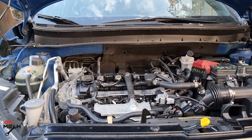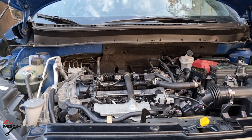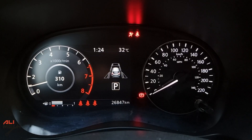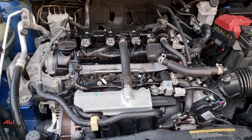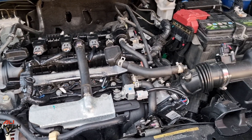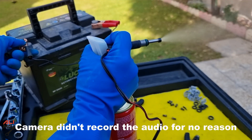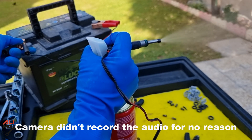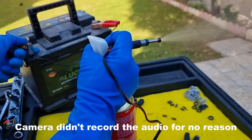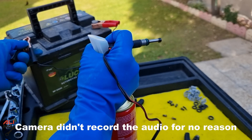All the wire harnesses and hoses are back on the engine. Now we're going to start the engine. It will start a bit late the first time — that's normal because the fuel injectors and fuel rail are empty and it takes time to refill them with fuel and push the air out. You should have a stable-running engine like this. If you experience a shaking engine after cleaning, one or more harness connectors may not be seated correctly, or you have a leak from the O-rings. Hope you guys found the video useful! I'll leave a real-time clip so you can see how long it took to clean one leaking fuel injector. Products used will be in the description. Thanks for watching!